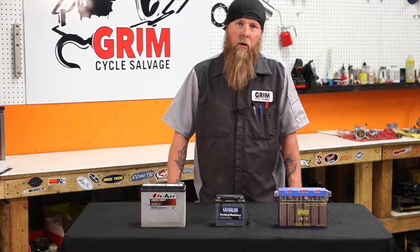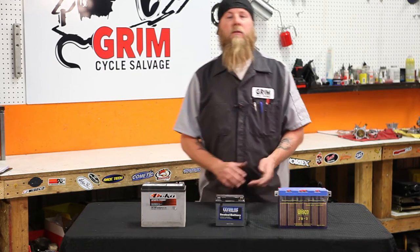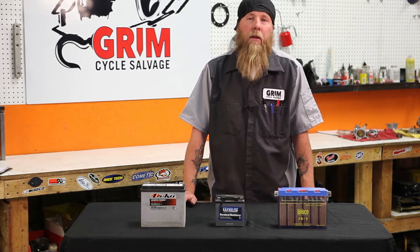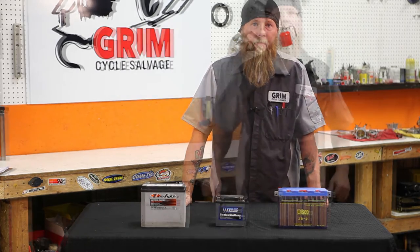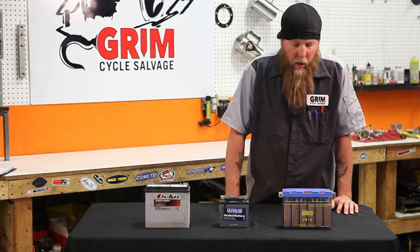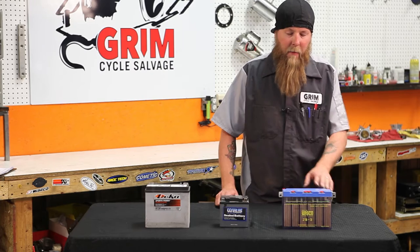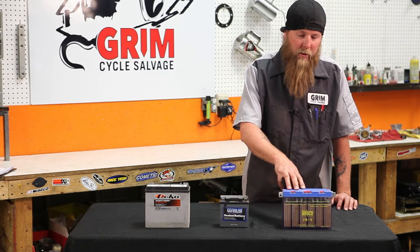One of the major components of your charging system is your battery. Batteries store DC voltage — they don't make voltage. Batteries are comprised of a series of lead plates separated by a sheet of insulator. Along with electrolyte, which is a mixture of sulfuric acid and distilled water, this creates an environment for electricity to be stored. Traditional lead acid batteries are vented — they will lose electrolyte because of evaporation, so they are a maintenance battery. They traditionally have lower cold cranking amps. Even if maintained well, the best you're going to get is a year or two out of one of these.